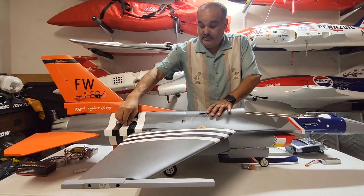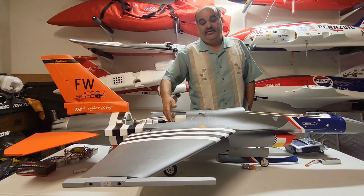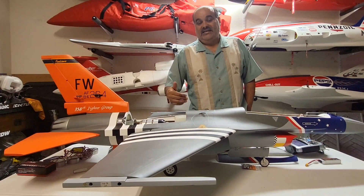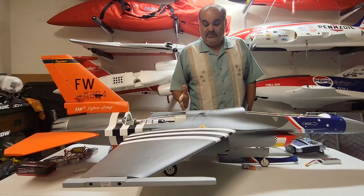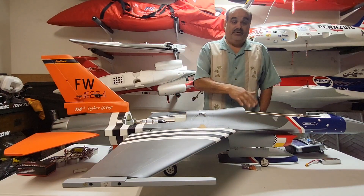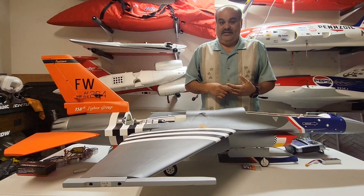One of the main things I did — and I tell the other guys too — is move the fuel tank as far back as possible, right next to the wing spar. Put a little piece of foam in there so the tank isn't rubbing on the fiberglass tube of the wing spar. Moving the tank far back means most of your fuel is near CG — it'll still be slightly forward of CG but won't affect it much. Put your fuel pump placement wherever you want; I put mine right next to the UAT.